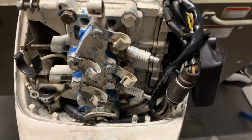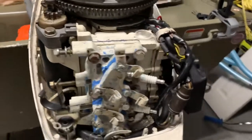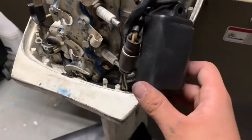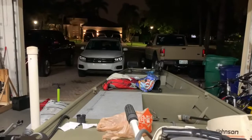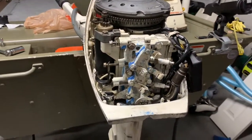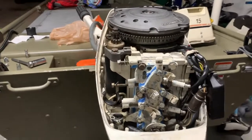I think it's not gonna leak at all. I pulled the cord and the compression feels pretty darn good. The only thing left to do is reconnect all the wiring and connect all the coils, but I'm probably gonna do that tomorrow because it's a little late. So I'll see you guys tomorrow.